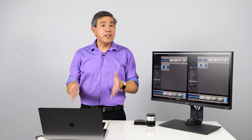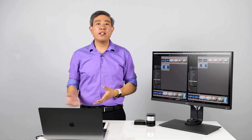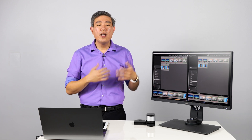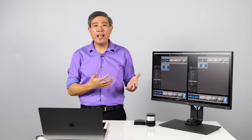It is always a good idea to check though — go into your system preferences or Windows display settings and verify that you are using the correct ICC profile before you do color-critical work. This is especially important if you're running on a portable system like a laptop with an external display. Every time you disconnect and reconnect the display I would go in to double-check that the system is still using the correct ICC profile. At some point you'll be confident the system doesn't change it, but until then just double-check.